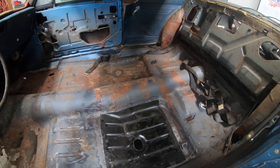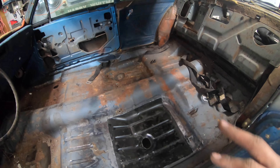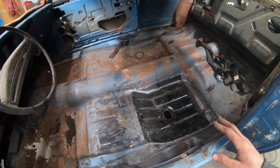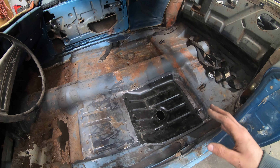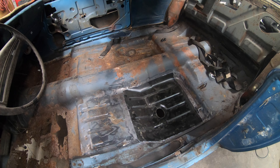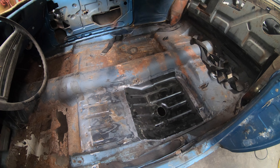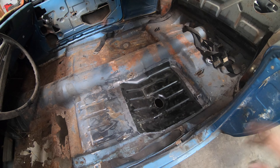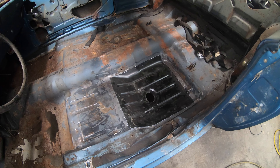I think that's going to wrap up using the cut-off wheel and everything from here I'm going to use a grinder and just kind of shave it down a little bit. The one thing I want to make sure I don't do is cut this panel too short. Leaving it long and being able to trim it down is going to be fine, but as soon as I cut too much off I can't put it back. So I'm just going to take my time and kind of shave it down until we get it right.